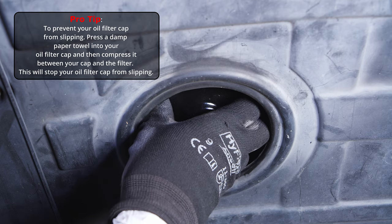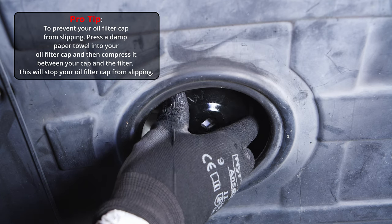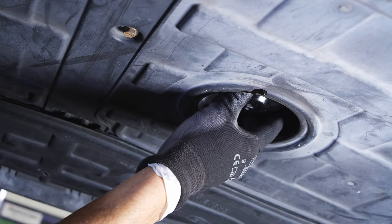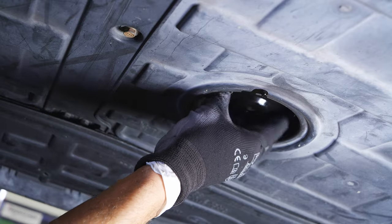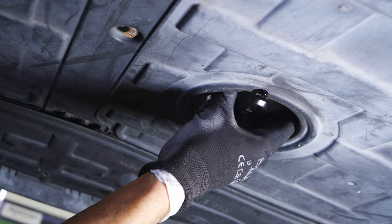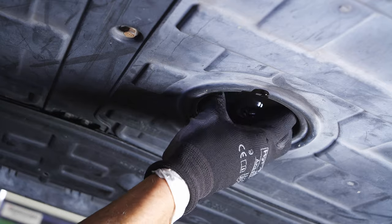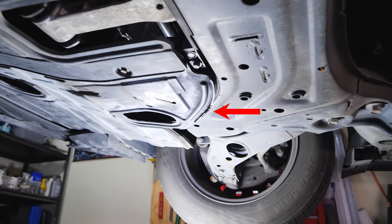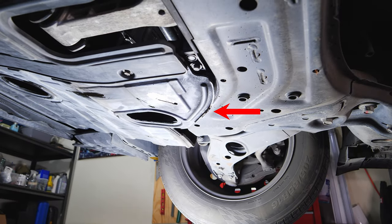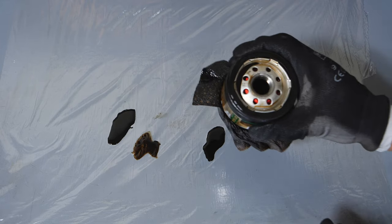You can see now the oil filter is unthreading nicely, which is what we want. Be careful because it will leak oil. Once it's loose, go ahead and use your hand to remove the filter — remove it kind of quickly and keep it as upright as you can, because that filter is full of oil and if you tilt it it will spill. Make sure your oil catch pan is underneath you. Also note that if you only lift up the front end of the car, the oil from the filter will drain down the paneling, so make sure you have a towel or rag there to catch it.